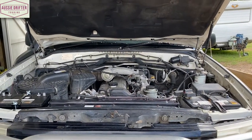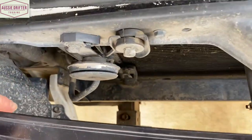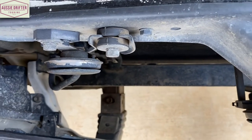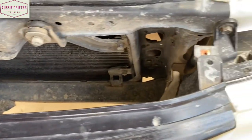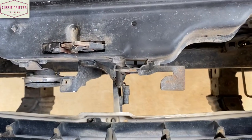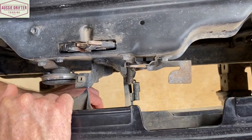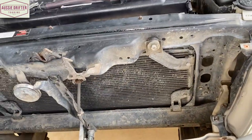Now looking down into the engine bay, on each side there are two little plastic clips. You'll see that clip — it's just a matter of pushing it towards the front of the vehicle and then lifting up. You can see we've released that one. We're going to go across to the passenger side and do the exact same thing: push that tab to release. Those two clips are released; there's just one little locator in here, so just pull the grille out, moving it a little bit to release that locator. Now our grille's out and we have full access to where we're going to install the charger.